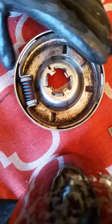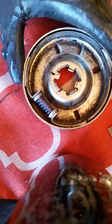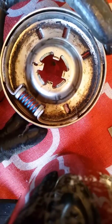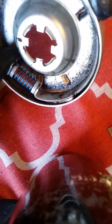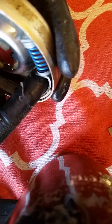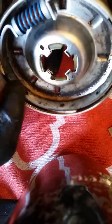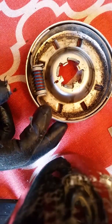This is for those of you that know you have a bad clutch. A simple sign of a bad clutch is that it basically connects to the transmission and spins the spin basket — it contacts here and spins the spin basket. It goes bad when you can turn it with your hand so easily. If I can turn it with my little finger, there's no way this is going to turn a 20-pound-plus load of clothes inside a washing machine.